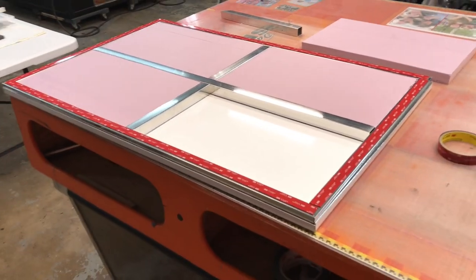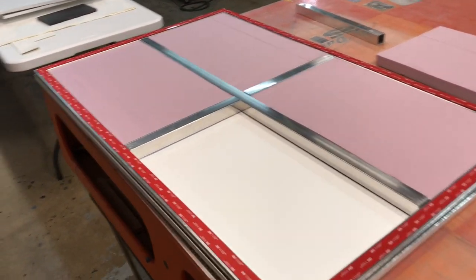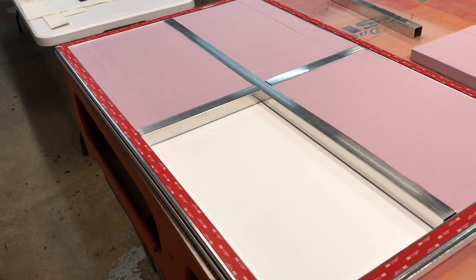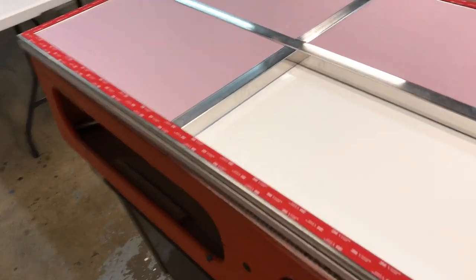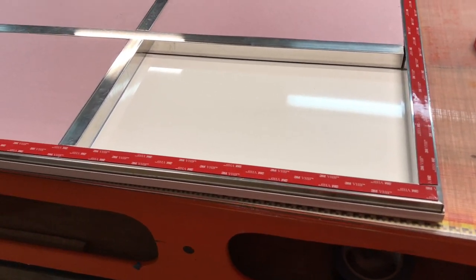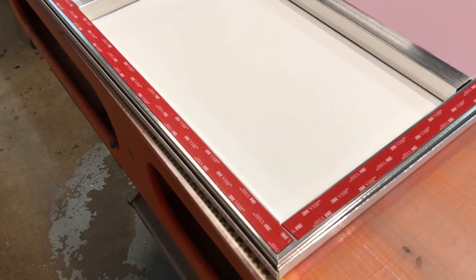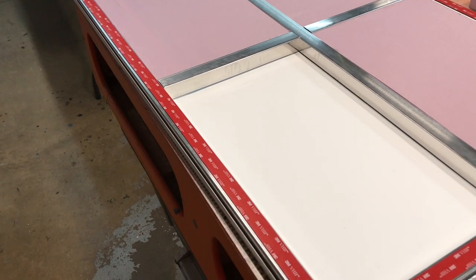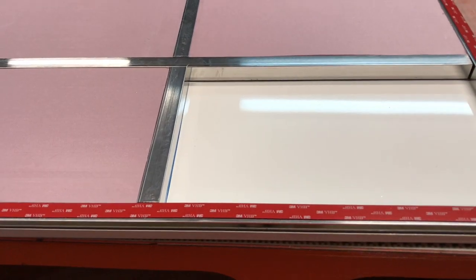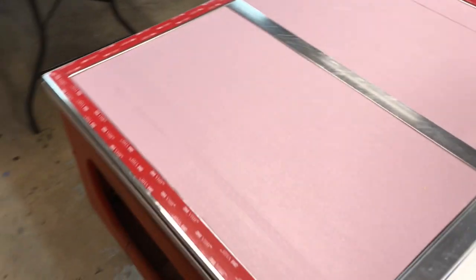Number one, there are no welds. The whole framing of this camper is based on 1-inch aluminum tubing on either 063 or 080 aluminum. By the time you bend the aluminum around this framing and use the double stick tape that I'm using, she doesn't go anywhere, and every piece is literally taped to it.